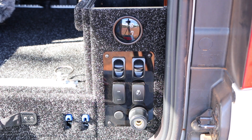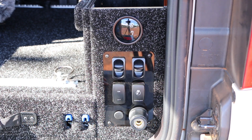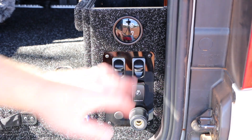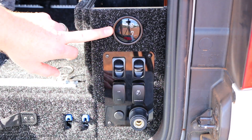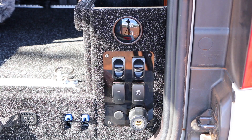I also have this wired so the compressor will not turn on unless the car is on. You always want to make sure your car is turned on when running these compressors — especially the twin — as they do draw a few amps, and you run the risk of draining the battery flat with the car off. However, I do have it wired so the compressor can turn on to increase pressures in the airbags. To do that it only takes about 20 seconds to get from low figures up to say 55 psi, and that 20 seconds of activation is not going to affect your battery much.